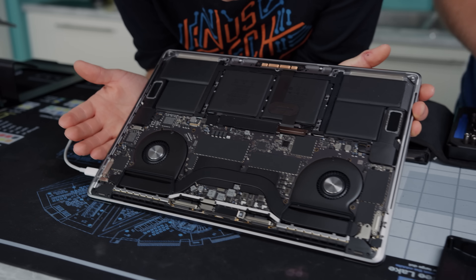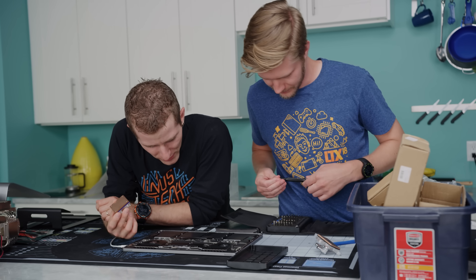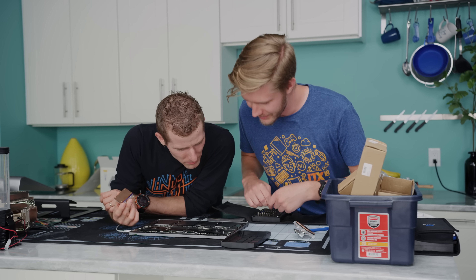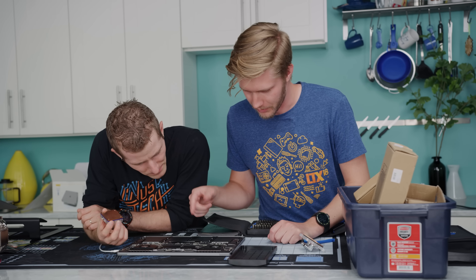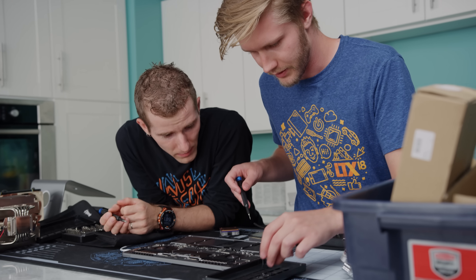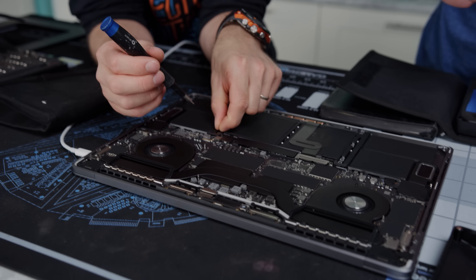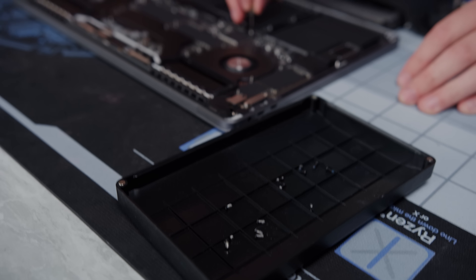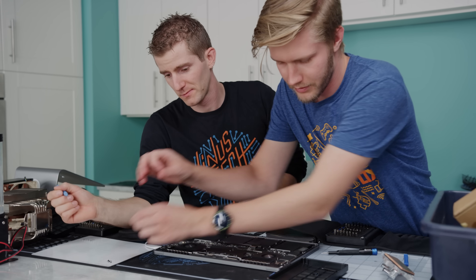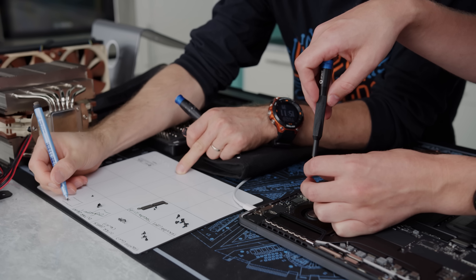So do you want to know my really bad idea that probably won't work? You want to water cool it. I really don't know if this is a very good idea. I don't even see how the heat pipe comes off. You have to take the whole board off — the screws are on the other side. We need to take the trackpad out first. Trackpad lower are these ones, trackpad upper are these ones, and there are T4s and T5s in here.